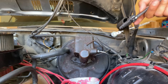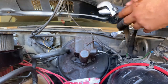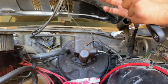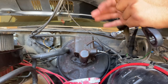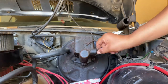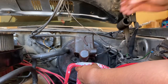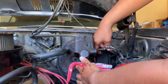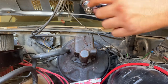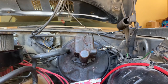We're going to try to make this work. Make sure you have something underneath to catch your fluid. Brake fluid is pretty corrosive — I'm not too worried about it right now, but if this car's engine area is going to be painted, I'll definitely be covering it up pretty good. Now we're going to use our short 14 millimeter for these two nuts right here, and I'm going to throw some PB Blaster on real quick.